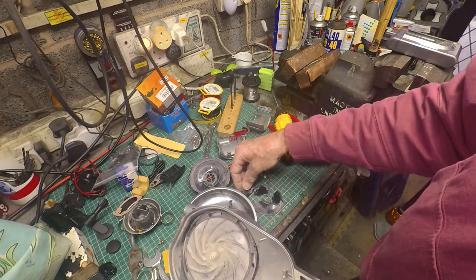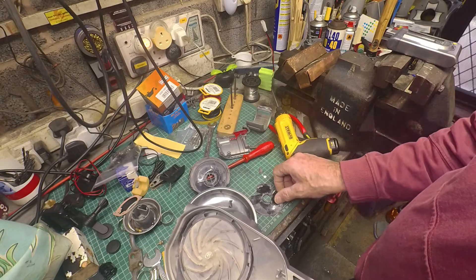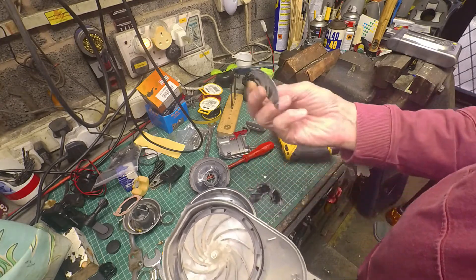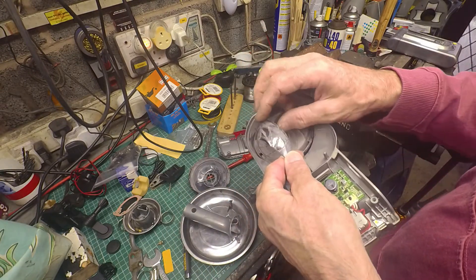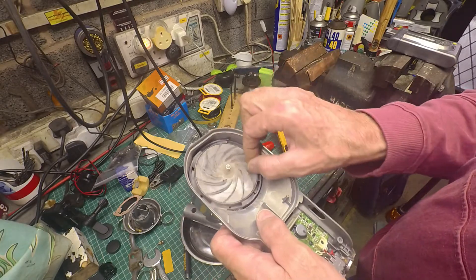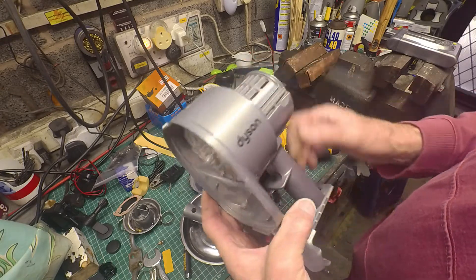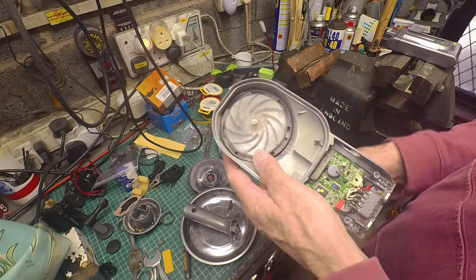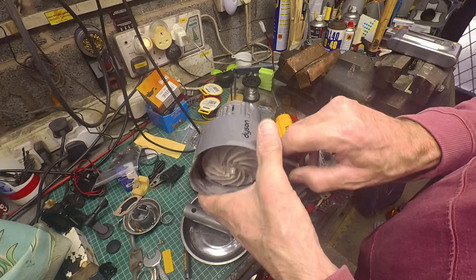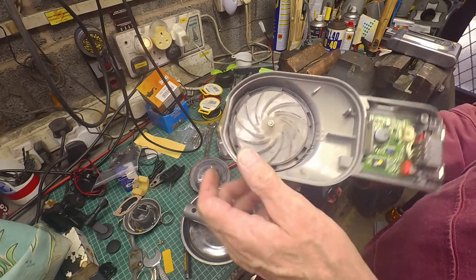Does this piece together? There's definitely bits missing — it's a pretty catastrophic failure. This used to have some kind of static vanes here, which have disappeared, which I guess improved the efficiency of this fan. So really it's just centrifugally drawing air along this spindle, throwing it out to the edge, and the high pressure air is going down these vanes on the outside, over the motor, and out this back end filter. It's not obvious how it comes out, but I think it must be glued in again.